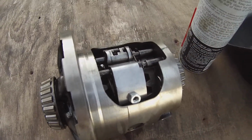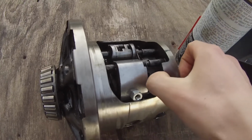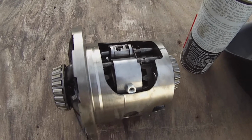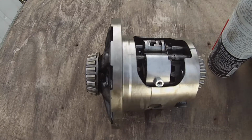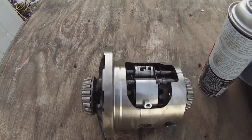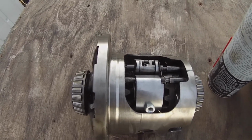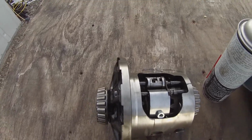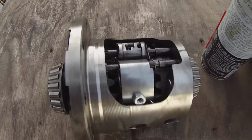You know, like if these diffs don't last all that long, then I'm not really losing anything by trying something new here. Welding this up, because I'd be going through a ditch or something, or a steep hill through a ravine, and I'd need some momentum to make it to the top of the hill, but over like 20 miles an hour they say these unlock, so then three-quarters of the way up the hill, I'm only getting one-wheel drive and then slow down, so I could see this improving there.